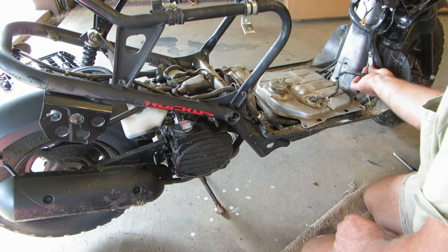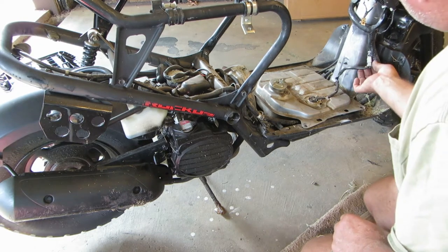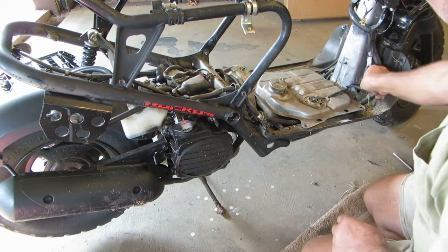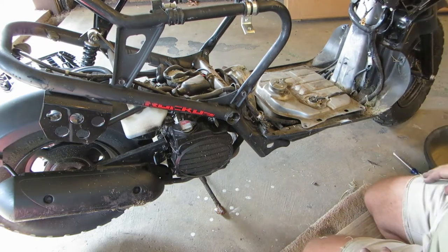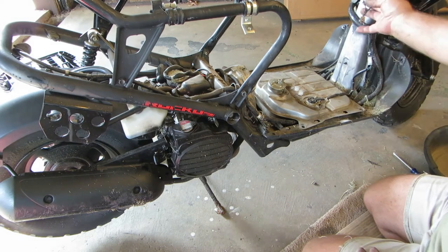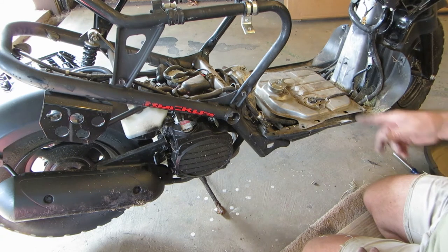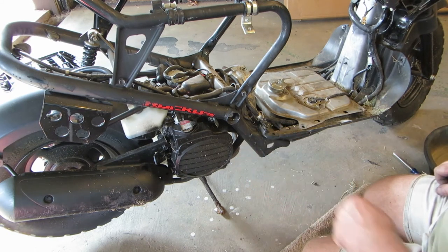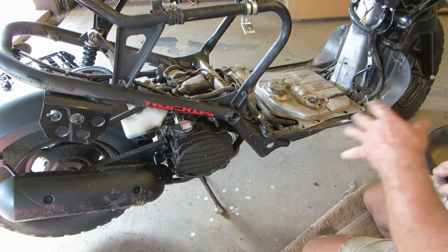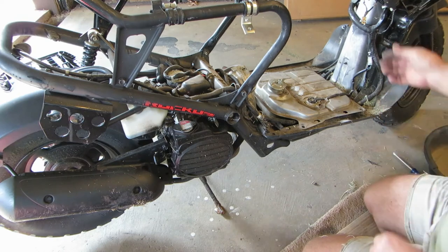if you turn the ignition on, the fuel pump should run because it has to produce fuel pressure for the carburetor. So regardless, I don't have to hot wire the fuel pump. All I got to do is solder these back together, which I will do before I put gas in this, and put some gas on it and crack that float bowl open on the carburetor and put a battery to it, and it should flow fuel out of it. So let's try that. Let's solder these back.